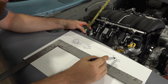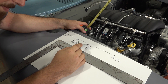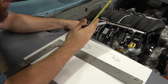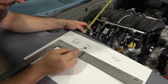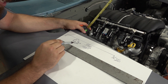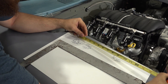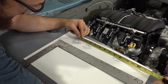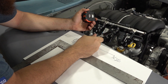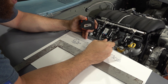If we know that a nine and a half inch wheel is actually ten and a half inches wide, we know that the center point of a ten and a half inch wide wheel is five and a quarter. That would be the point where a zero offset wheel's flange would be — it's also the center of the wheel. We know from using the wheel fitment tool that we're going to have a backspacing of two and three quarter inches, so that's where the mounting flange needs to be. Calculating offset is really as simple as measuring the distance between those two points — and that distance is two and a half inches, which is around negative 63 millimeters. It's negative because the flange is going outboard of center; if it were going inboard, that would be a positive offset.